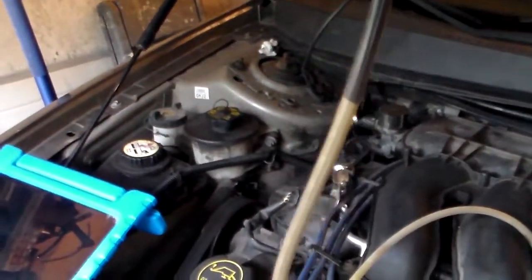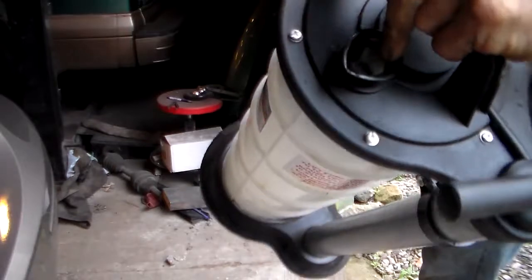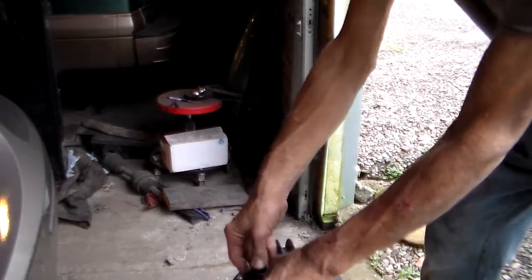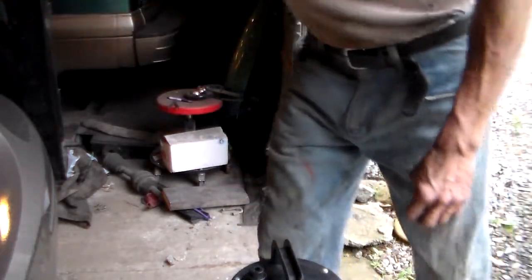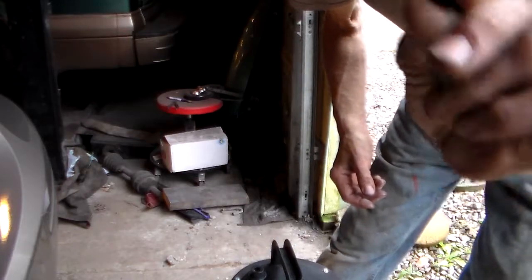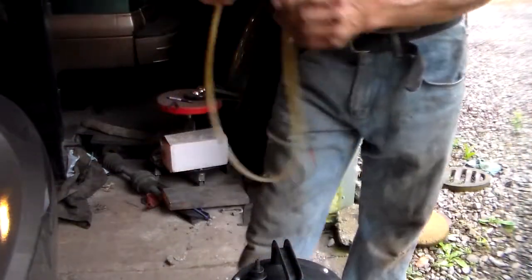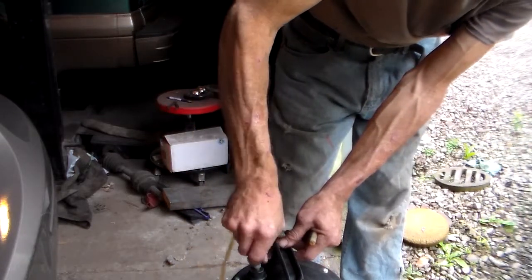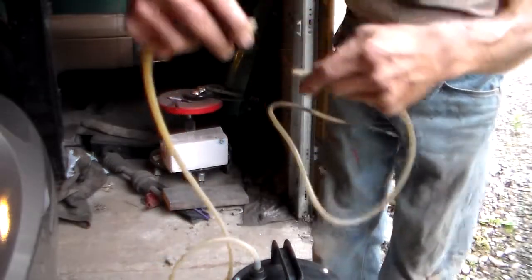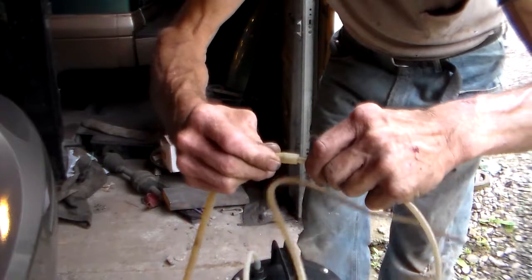For changing oil, this quarter inch hose is what's going to be going down in the dipstick tube. To set this up, we're first going to use this — hold it on top of the extractor itself, just push that in. We want the one that has the same opening on both sides, and that goes down in there. Then I'm going to take this, push that in there, and we're going to take our larger hose and push onto that and shove the smaller hose inside the larger one, which is a fairly snug fit.